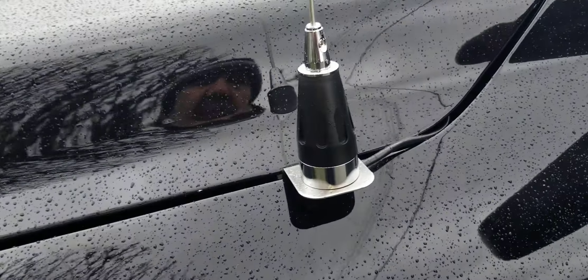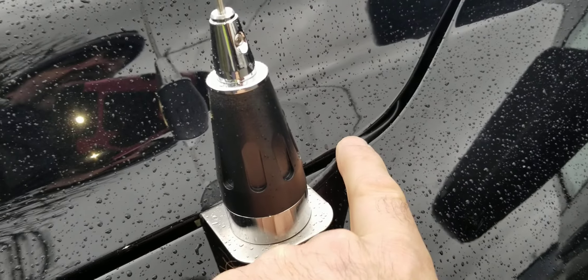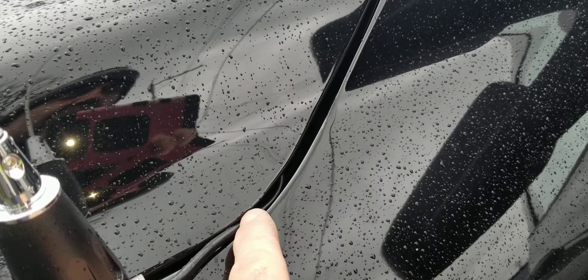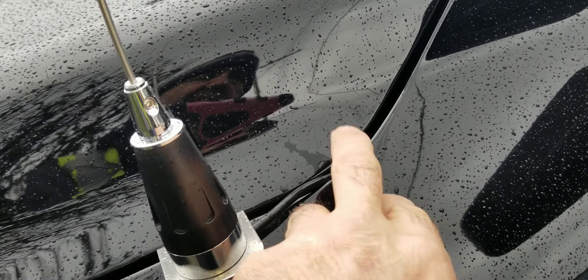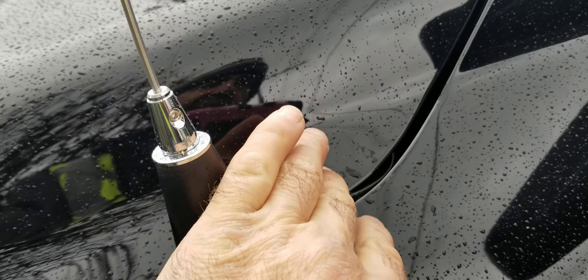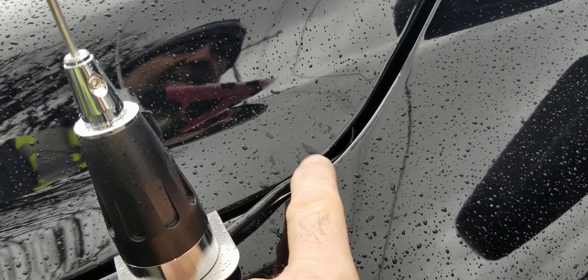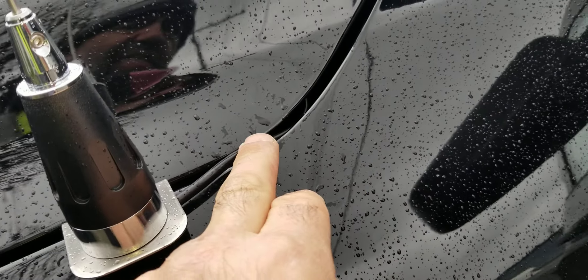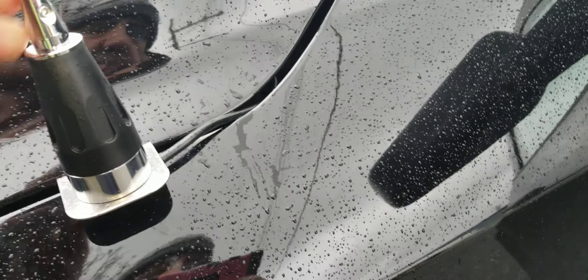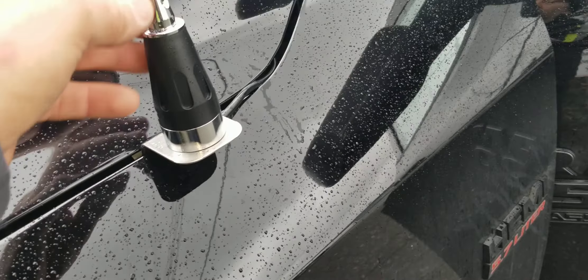The antenna is here. I could push the cable a little bit closer to the antenna, but the gap between the fender and the hood is larger here so it won't pinch the cable. In the summertime when things expand from heat and vibration, I often see cables being damaged right here. Once the plastic insulation is damaged, rain and water get in, corroding the ground, and you get poor performance. This is a custom-made bracket that we get from a supplier.